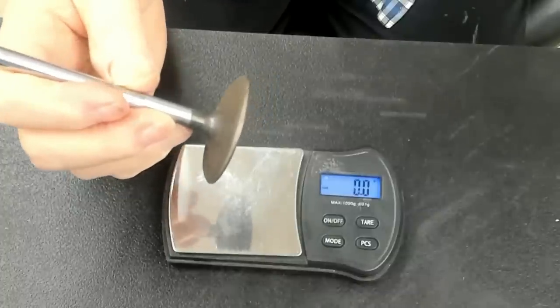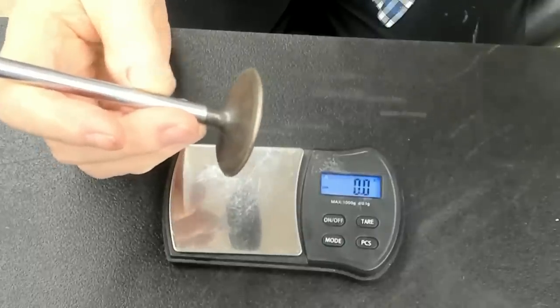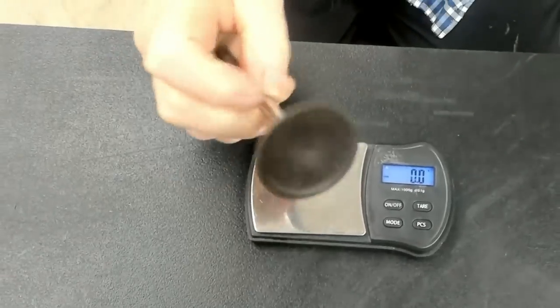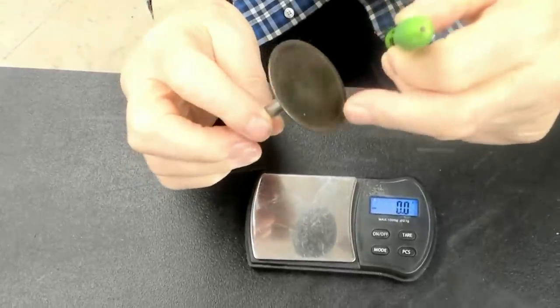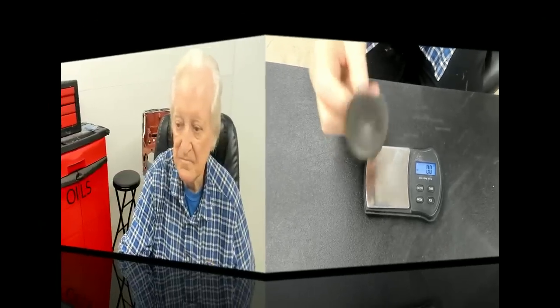LS valves don't seem to wear very much, even if the oil changes aren't really good. This one here has done about 150,000 miles and is showing virtually zero wear. By the time I've cleaned this one up, and there's a bit of lightening possible here, and I'm going to make it slightly anti-reversion in here, it will be a very good valve for what we're going to do.